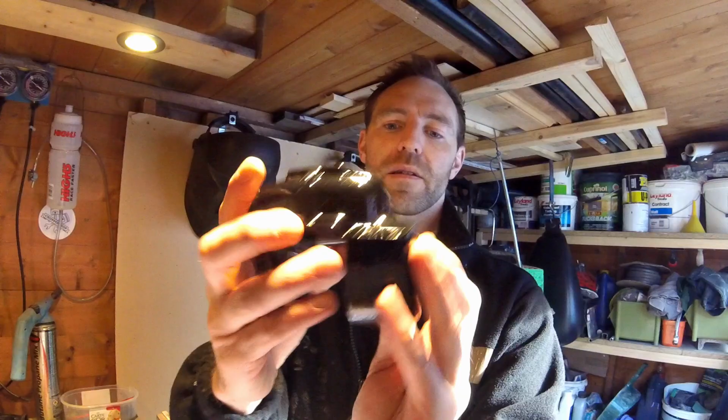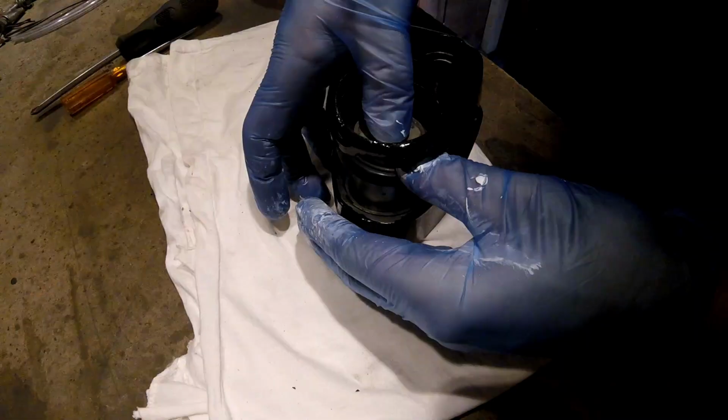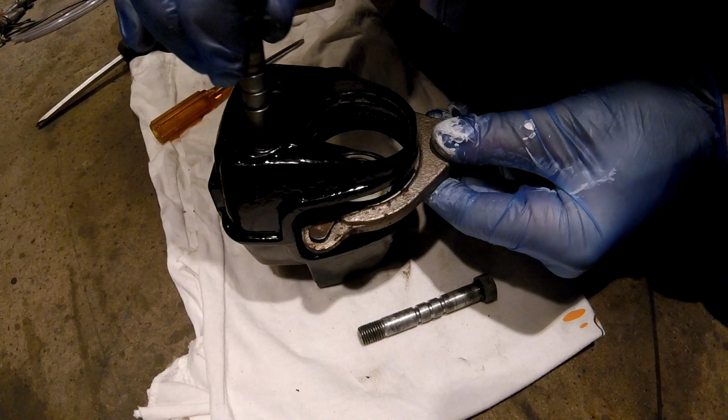So you can see there, there's our flushed bleed point section. Okay, so all I need to do now is put the brake piston back in, install the seals, sliders, and the cradle, and then I can stick it back on the GS. Also with the new braided brake hoses, so stick them on as well, and then get all the system bled through. Yeah, let's crack on.